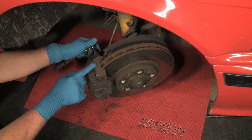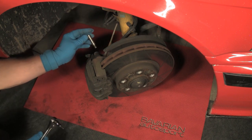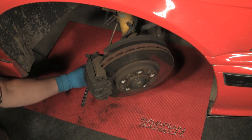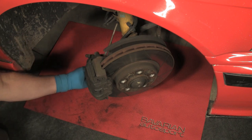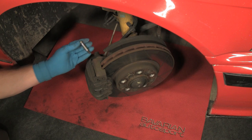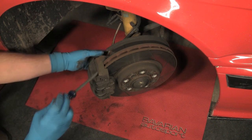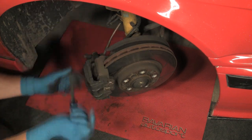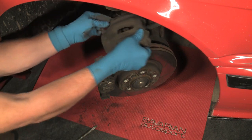This particular model uses the 7mm bit. Simply unscrew the guide bolt. Once the guide bolt is fully unthreaded from the bracket, we'll use the tool to pull the bolt out, and we can pull the guide bolt all the way out. We'll clean and lube this later on. Now that the caliper is loose and we've removed the guide bolts, we'll pry the caliper off using a small pry bar or a large screwdriver.